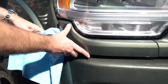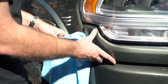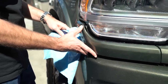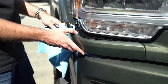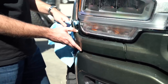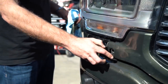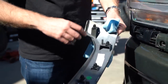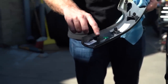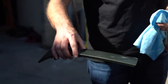We'll work our way from the back — you can see I have the panel remover behind here. This is going to feel like it's going to break, but fortunately in our case it did not. You'll have actually four different clips that clip into the headlight assembly, and you'll work your way from back all the way to the front. It should slide out and pop right out just like that. There are four pieces, as well as a locating piece that goes to the center shroud, so we have to be very careful not to damage any of these as the whole assembly is plastic.